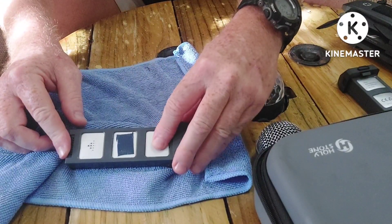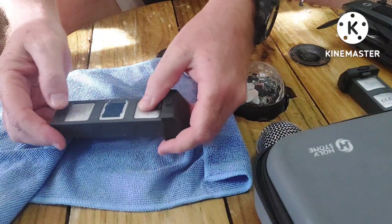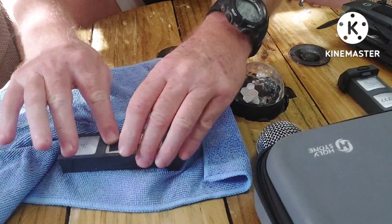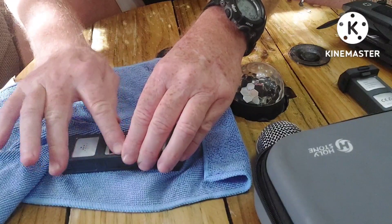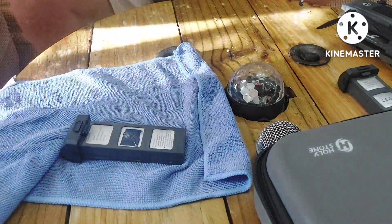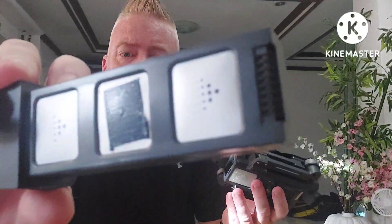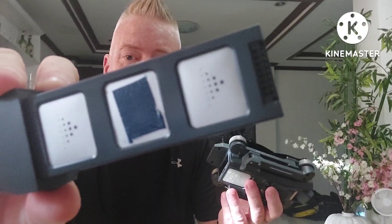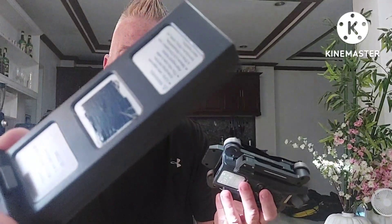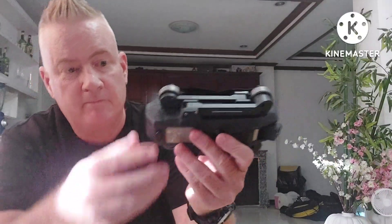You can really see how loose this is - I could even shift this around. It was so tight before it was bowing out the plastic on both sides. Now you can actually feel the battery pack moving around in there. Huge difference. Let's hope that tape stays and prevents other gas leaks. Now let's test it and see if it's going to fit in the drone. Here's my battery - it's patched on this side and patched on this side. I had bubbles on both sides and I couldn't get the gas out from one side. I had to pop both of them. Look at that - like butter, just slid right in.